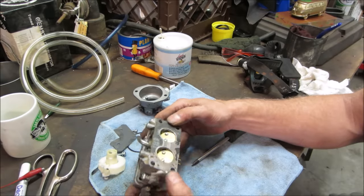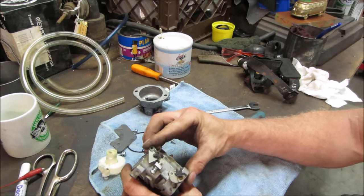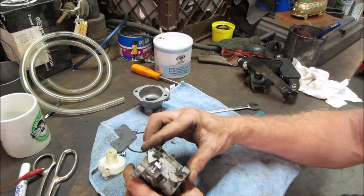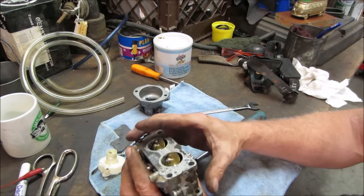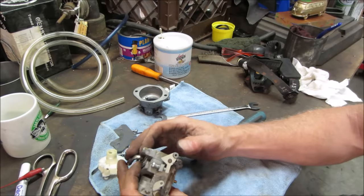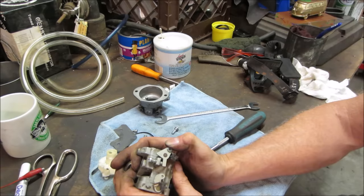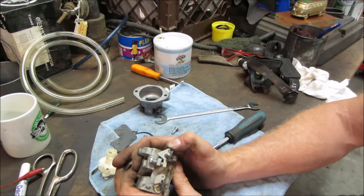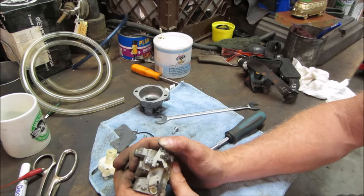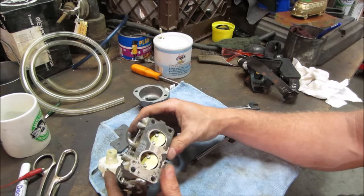It has no idle. What was happening? You should be able to go right against that stop, essentially, or close to it, right at idle, and it should just hold at an idle. What was happening was, it's running fine, full throttle, idle. When it's revving up, it's on full throttle, and then you go back to the idle position, it should maintain there. What it was, it was just falling off, getting no fuel at all, would die, the governor would want to go full throttle, it would recover again, and rev up and say, okay, you're revving too high, and then go back down towards idle, and then there was just nothing there, it would die, and then give it full throttle again. That's that hunting that you hear going up and down.